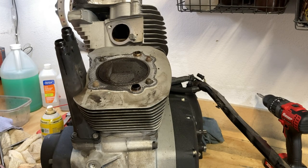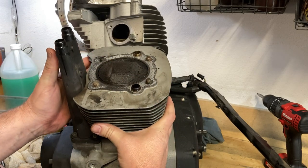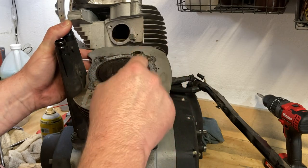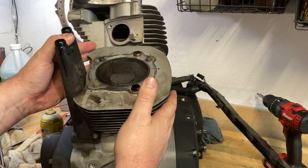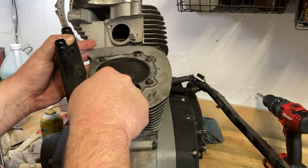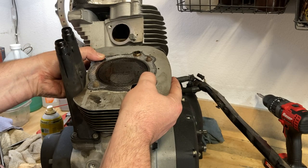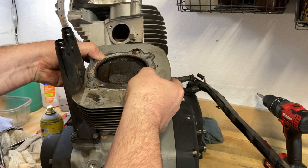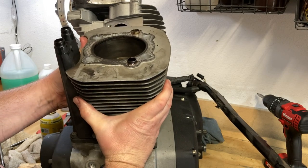Anyways, just some things on my mind — these are the kinds of things I think about. I'm going to go for it. We're going to sacrifice this cylinder. What I wanted to do is keep the piston in the cylinder and raise it up so I could pull the pin and take the cylinder off as one unit. But I think what I want to do instead is see the skirt, because these pistons are not going to be reused. I am going to go ahead and remove everything, being careful not to allow the rod to slap anything as I'm pulling.